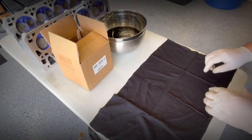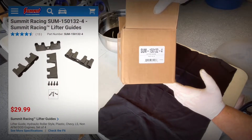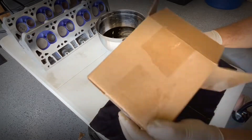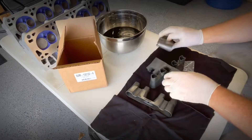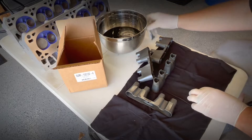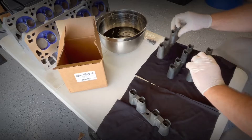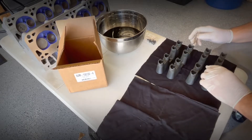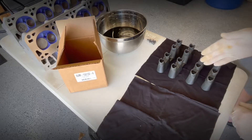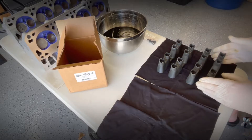We're going to get these lifters loaded and rocking, ready to go in the guides. What we have here are Summit lifters and lifter guides — get them all out with new hardware. Obviously when you put the lifter in it only fits one way, but the roller wants to go perpendicular to the way the guides are.